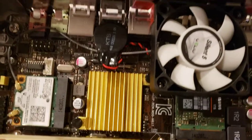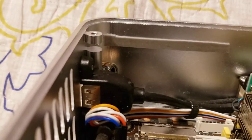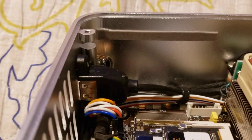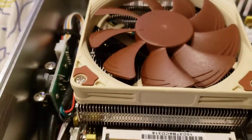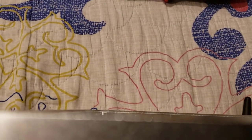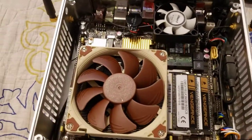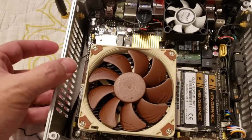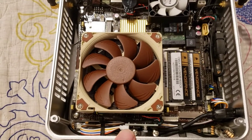I put that in there with a double-sided adhesive, high-temp. I did it over here because I was gonna put a hard drive in and just stick it like that. Then I put this cooler here because I had a micro little tiny cooler that was smaller than this one and it wasn't doing the job. This guy doesn't have enough space here for air circulation — he pulls air from the top, and since the cover doesn't have any holes or grooves — which I'm gonna be doing — when I do it I'm gonna do another small review so you guys can see. That's gonna help a lot with ventilation.